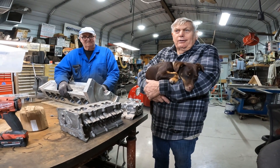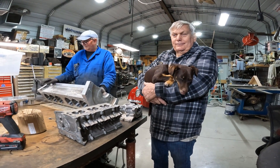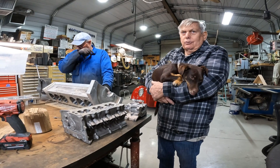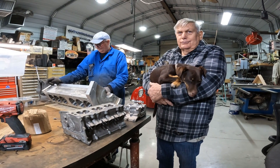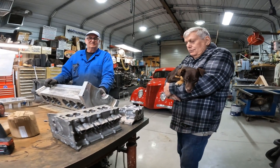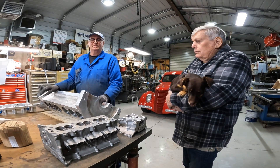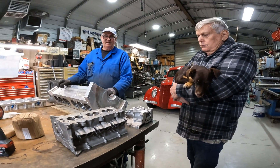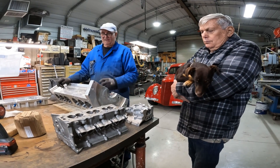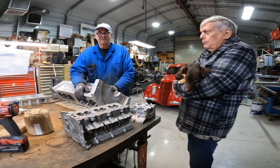Nobody wants to go to Bonneville with a four-liter engine — they're not going to go fast enough. Nobody makes a big four-valve engine, though Mercury Marine makes one. The Corvette 5.7 LT5 is a Lotus head but it was a production car — the combustion chambers and port angles aren't as good. This was a race motor made to go fast. It's 20-year-old technology but it's way ahead of what's on the street today. We wanted six liters, so we accomplished that by cutting a bunch of heads up.